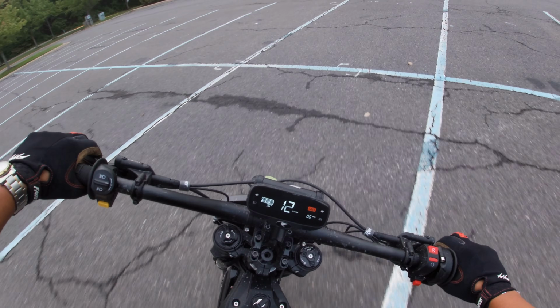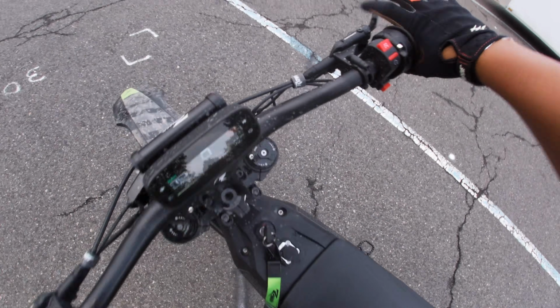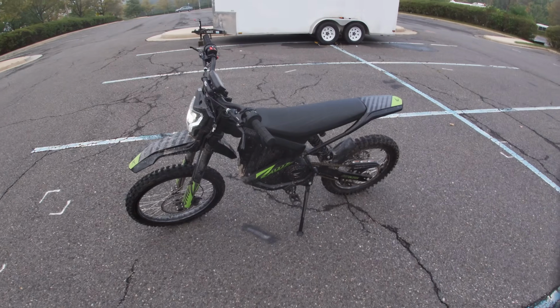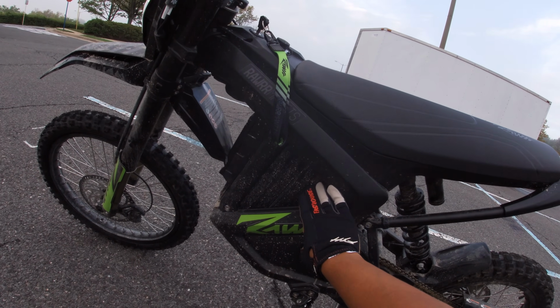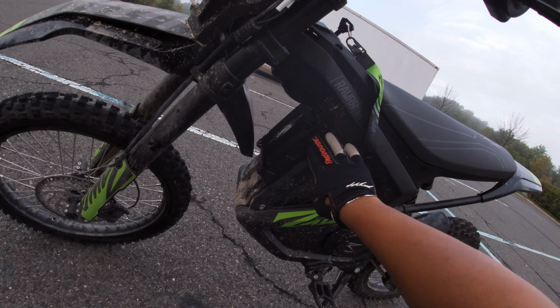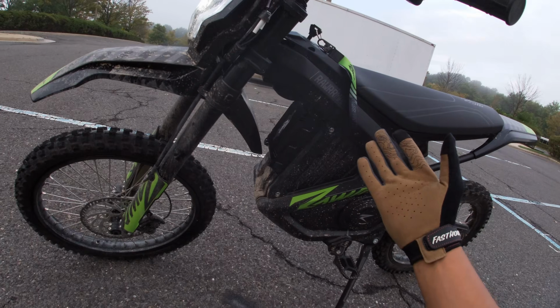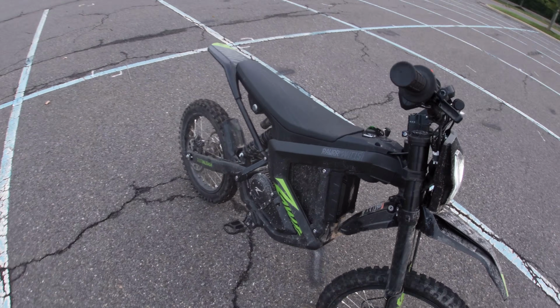I have been looking at upgrades for this thing while we had it waiting for a week and a half while the controller was out of it. And I was able to confirm that the stock battery output is 90 amps continuous. So with the battery BMS being perfectly matched with the 90 amp output of the factory controller, there might not be a point of upgrading the controller just yet, unless you're gonna upgrade the battery at the same time.